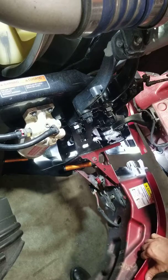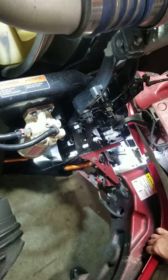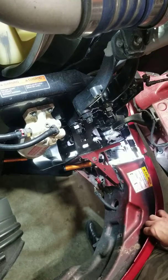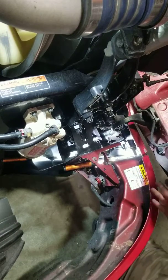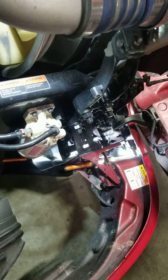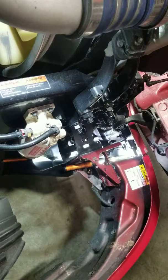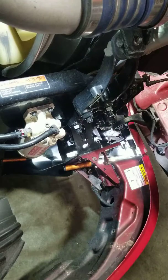Again, you align it with this bracket, and then you try to align into the bottom, this side. Set them all inside, and then you just move it up and down and give pressure with the knee from the outside. It goes in, push this in, turn it, tighten it down until it stops. Reconnect the fog light, and you're done.